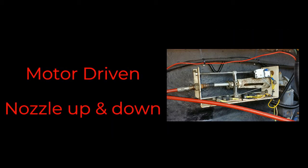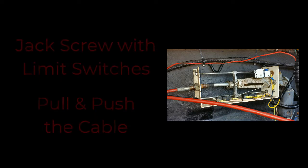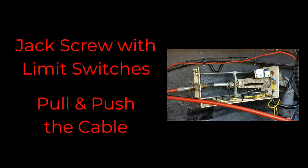The jetivator is this little box hanging on the transom. It's basically run by a geared electric motor with a jack screw, and what it does is it pushes and pulls on a cable that goes through the transom and hooks to the nozzle, and moves the nozzle up or down to trim the boat. And of course, this comes from a little two-position switch on the dash.